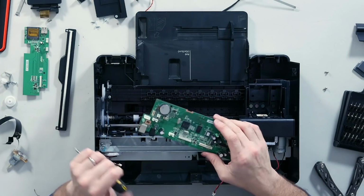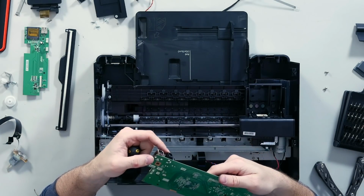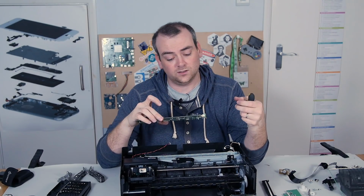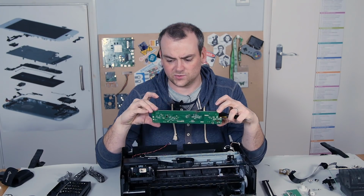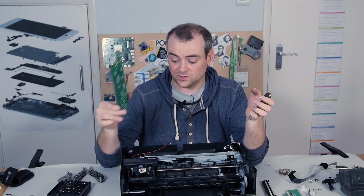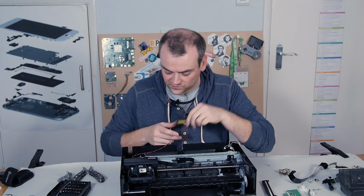Oh, the other thing I should also mention, which I haven't covered already, is there's no onboard power supply. This just takes, I think, a 19 volt external power supply, so you don't need a transformer, bridge rectification or mains voltage in here at all. Of course, that's probably a feature of international selling, that they just change the external power brick, nothing inside has to change. But it also keeps the cost of components down, because they can buy that external power brick en masse, just ask for it with different labels on it from the manufacturer.